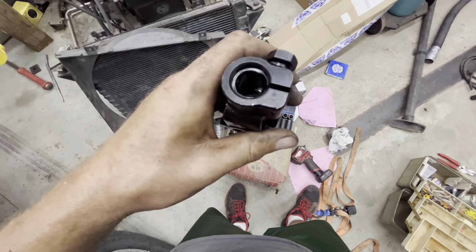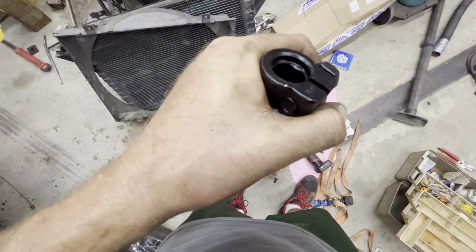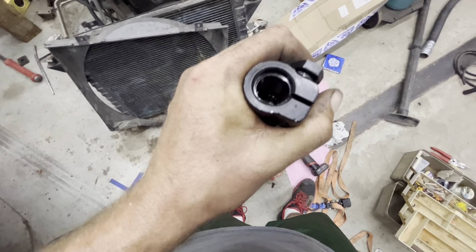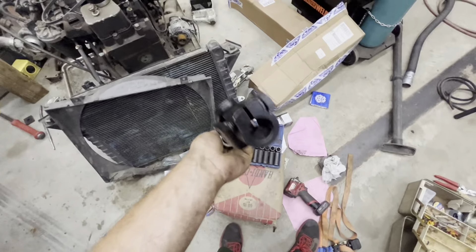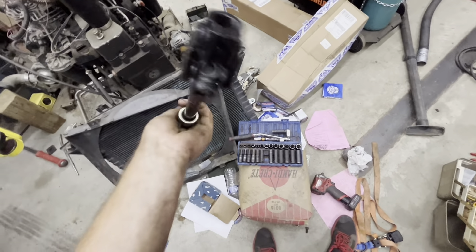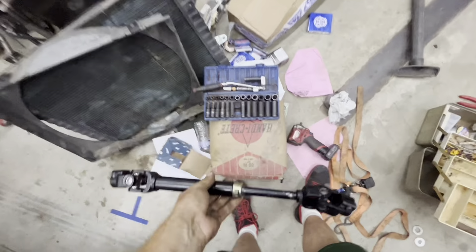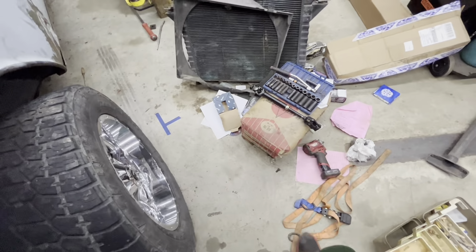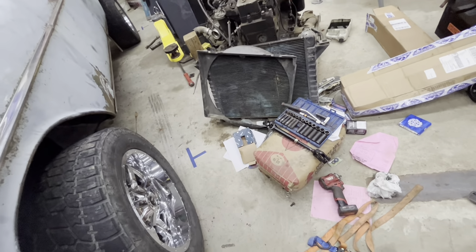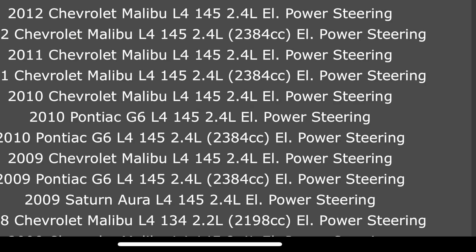I like this shaft and I like that wheel because it's splined. Any time I get it in alignment, I can just re-center the wheel and it won't be a problem. The top end has a bushing — I'm not sure what kind, but we're just going to leave it as a bushing and not a bearing, because that's what it came with originally. I'm going to have to cut this down some more and then grind down and make two flat spots, one on each side. I think that's called a double-D shaft.